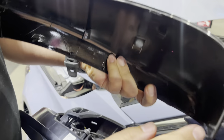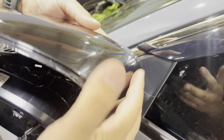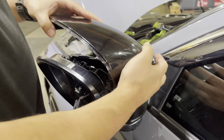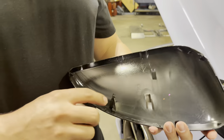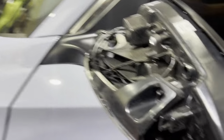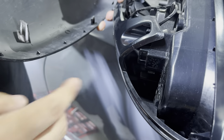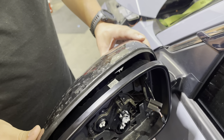As you've seen, I just shook outward these three tabs — you have this one, this one, and this one. You don't push that way; I just jiggled it up and down from front and back and it pops out like that. So when we put the new one on, we've got to make sure these three tabs line up and then push it back in place. This tooth has to line up down here, this one up here, and this one right here on the side slant. So you need to get these in and put it on evenly.